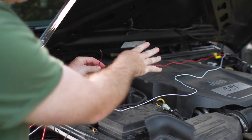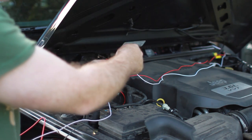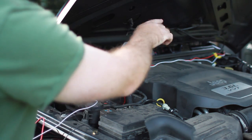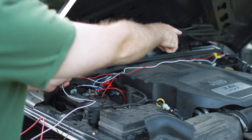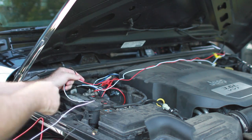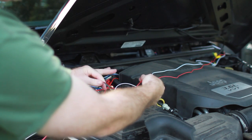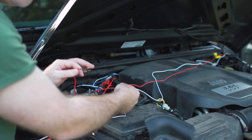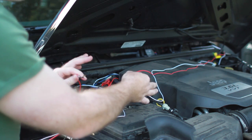Now that I've got the wires coming through here, the red wire and the white wire can come off of the switch. I'm going to tuck them behind here to keep everything nice and neat. The black wire comes out and that's actually just a ground wire — it's very short. I've got that connected to a bolt on the driver's side along here; you just loosen it up, pop the wire under there, and tighten it down. In your Jeep, if you don't have any other light bars, you won't have anything else here. I have the light bar from up top hooked up here. I'm going to do a follow-up video on how to organize this even better because right now it's getting a little messy.